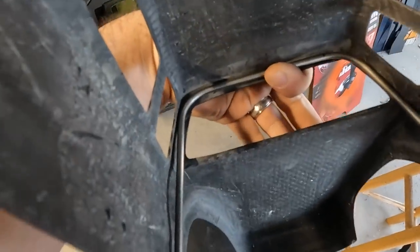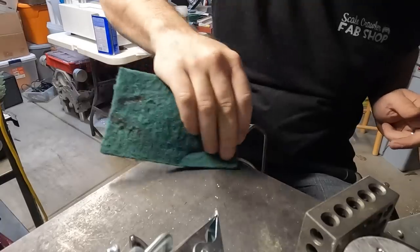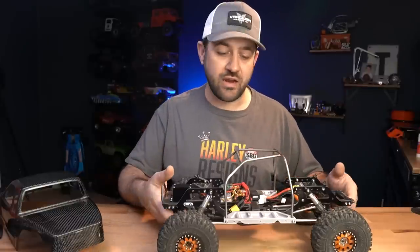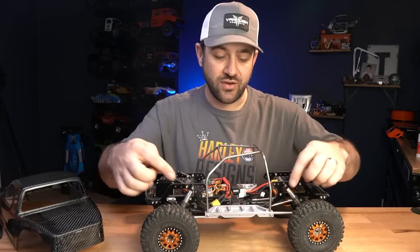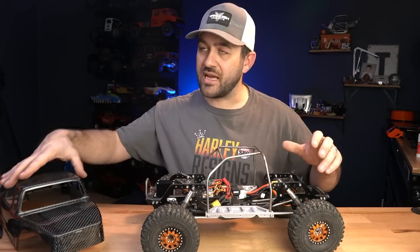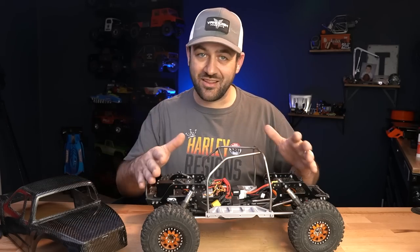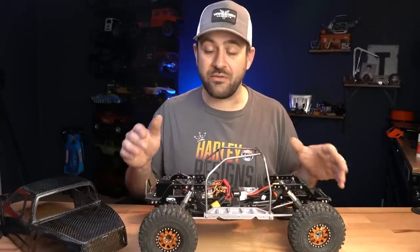Since I had to make the titanium fit to a body, I had to do a little bit of extra work, and making sure everything was perfect was more difficult. After I was done, the legs of this titanium cage were at excess length — I didn't really know exactly where they needed to be so the body could sit down onto the chassis properly and still meet up to the roof. So I started working on my sliders. These are 3D printed and very rough. The whole point was that I created holes at the corners where the cage could slide in, with a couple of three millimeter screws on the outside, so I could get the cage in place, tighten the screws down, check the fitment, go back and adjust. That way I know exactly the height the cage needs to be.